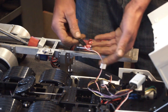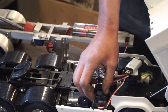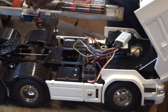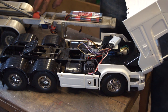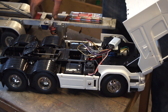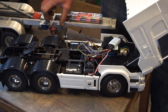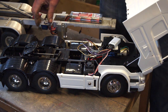When using this you leave everything intact and just plug it straight in. If you're using a speed controller, like what's on this wagon here, your speed controller sets up exactly the same way as you would if using one on a trailer. You don't need a big speed controller for these motors — they don't draw a lot of amps. A Viper Marine speed controller, around 15 to 20 pound, is generally sufficient. Using a speed controller is the easiest, quickest way, and it's a lot more foolproof.